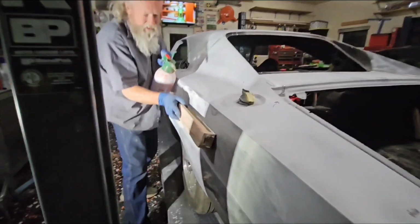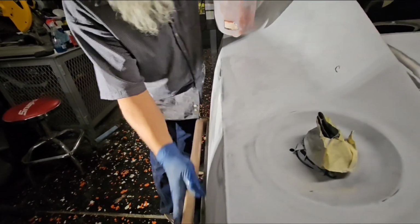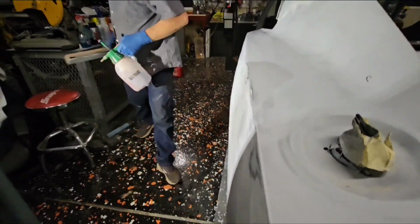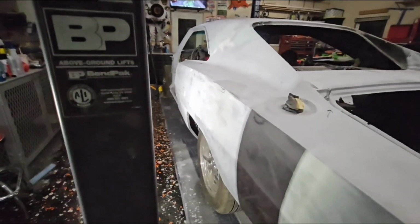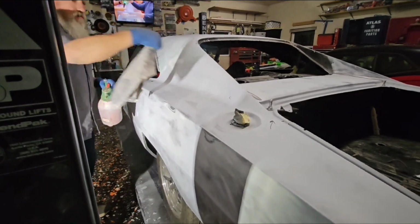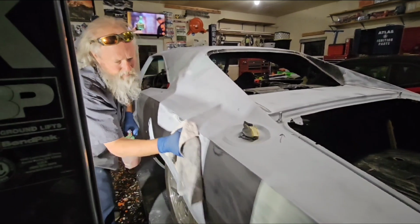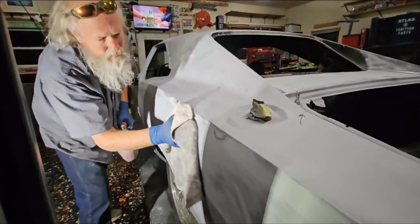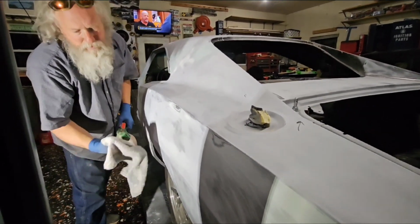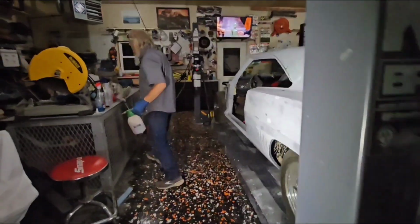Yeah. And I don't see any light there. There you go. Maybe we'll plate it just to see if there's anything there, but I physically can't feel it. Usually if you see it, you can feel it. Yeah. I'm gonna do my rag test. I'm feeling something along here. We'll just blade it. It's saying it's there, so I'm gonna sand that and then we'll go back and blade that.